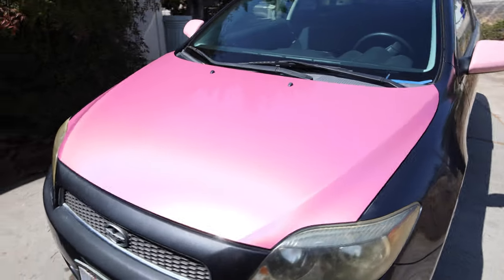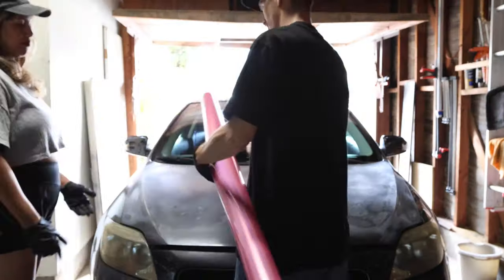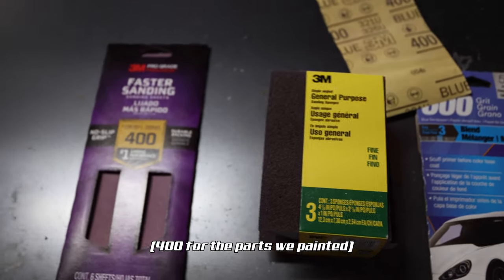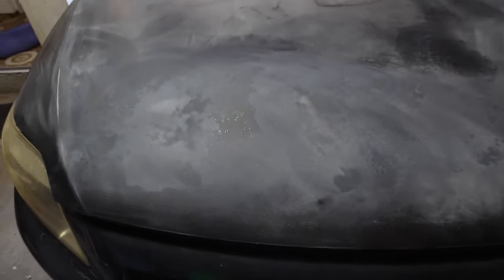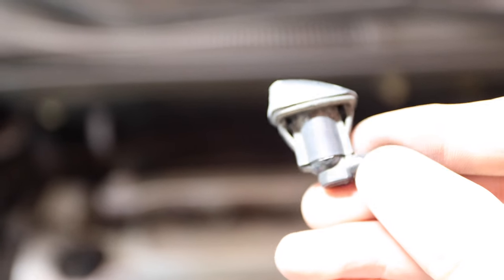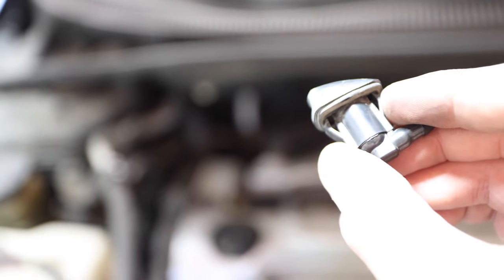After all the painting stuff was done, we did the vinyl work. My girlfriend found a psychedelic pink vinyl that has like a rainbow effect like on the back of a CD. The first piece we did was the biggest — the hood. We got the hood sanded down, starting with 600 grit, mainly trying to get the damaged clear coat off and get everything smooth so the vinyl would have something to stick to. We sanded the whole hood down with 600 to get it nice and even, then washed it really well with some alcohol and a microfiber. You also have to remove the little washer fluid nozzles — just use a screwdriver through the hole to push the tab and squeeze them out.